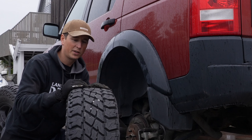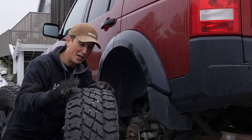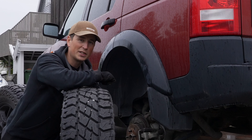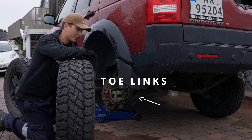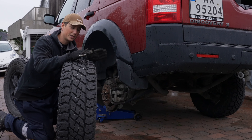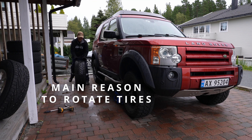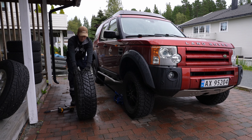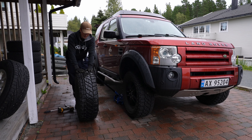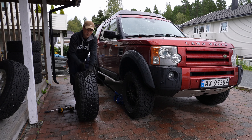From my experience I can see more wear on the outer side on the front because of turning, and in the rear, because of weight or bad bushings in the suspension or the tie rods, you get more wear on the inner side. So the main reason is even wear, to prolong the life of our tires, and to keep them in a drivable state as long as we can — avoiding vibrations and keeping the tire running true when you are driving.